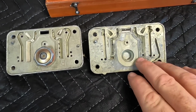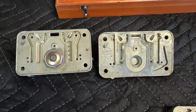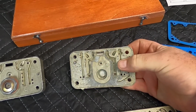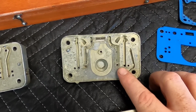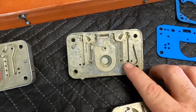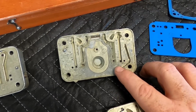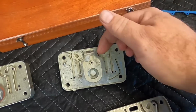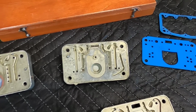So I've always been the type, I like to have them down low, below the fuel level, but that's a subject for another day. So based off of my experiences with the 660 center squirters and getting excellent drivability out of them, these things from Holley come with a 37 thousandths idle feed restriction. Huge, okay? Now granted, from Holley, it's a 2-corner idle mixture deal instead of 4-corner. So you got to take that into consideration as well. So when I put extra set of metering blocks on my center squirters, I actually use 600 vacuum secondary blocks to do it.